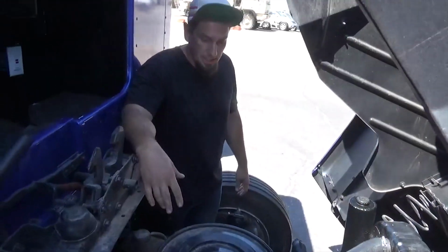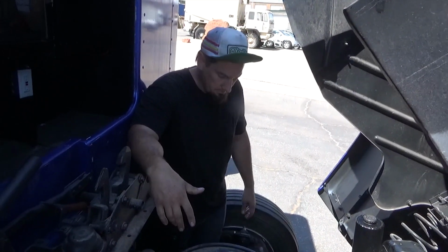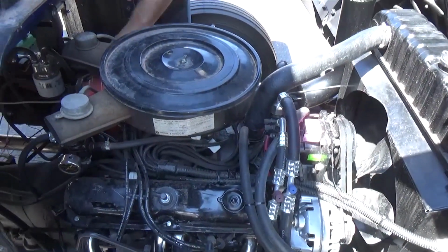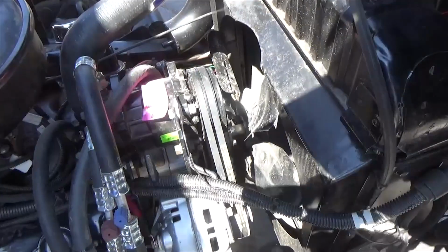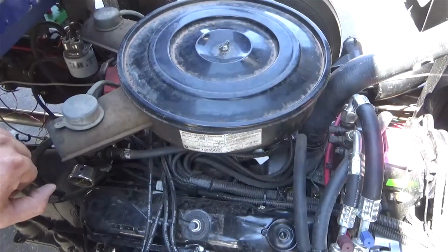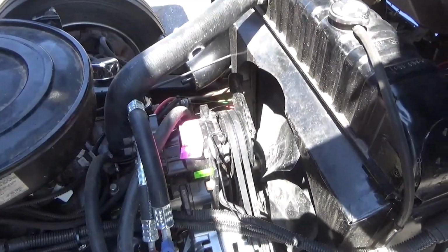And then powertrain is a small block Mopar. It's a 408 stroker kit, and it's running a fast EFI system. We have an HEI style distributor. We got the original radiator. We were able to fit everything together with again, which was pretty amazing because we had to move the motor down and a few different things when we switched to this one.